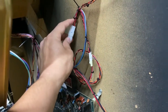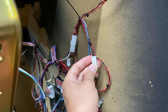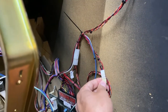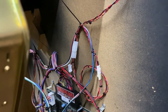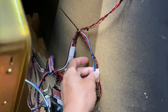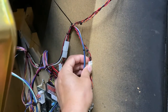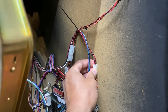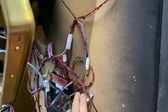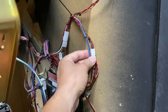I took the harness I got and made a loop so the blacks are in the middle and the positives for the speakers are on the outside — essentially what you would do on top when you put two speakers in parallel. When you put them in parallel, you take the ohm rating and cut it in half. The positive wire goes to both positives and the negative goes to both negatives. So if I have two 8-ohm speakers I end up with a 4-ohm load on the board. Before, the negatives were tied together and they ran one signal to each positive, which adds two 8-ohm speakers together giving you 16 ohms, which this board is not rated for. Long term that may damage the board or produce undesirable sound, so this is the acceptable way to do it.